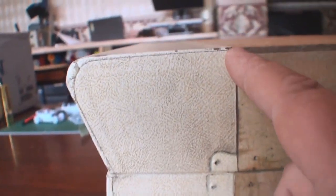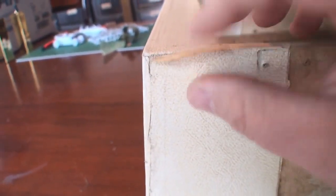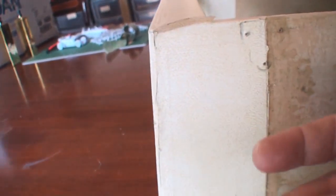As you can see here, look at this lid for example — the whole unit isn't done in one piece. The lid, they've just cut around and put a little segment in there like that. The front panel looks like it's all in one piece. So this varies — I've seen different Dansettes done different ways. They obviously all had their own independent ways of doing the recovering. This one's got a seam here — I've just lifted that up now because I washed all this down beforehand, and that glue is sticky. I can feel it sticking on my fingers. So if I was to wet all this down, definitely with a steam cleaner, this would come off very easily. But it's got to be sanded down anyway, so that's why I'm doing it this way.